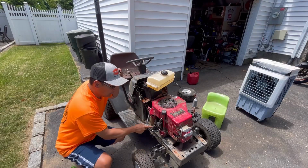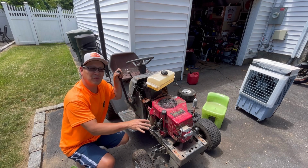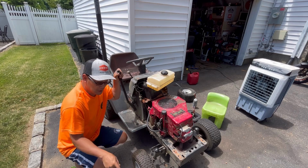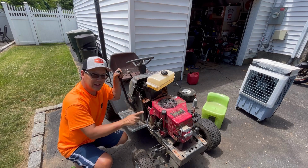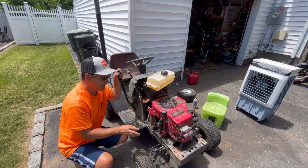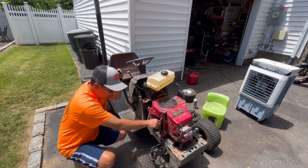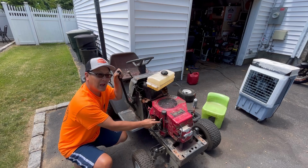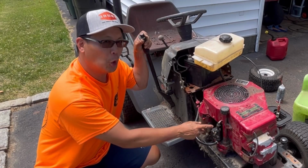As you saw, I took apart the mechanical fuel pump. It had all kinds of crap in it, rusted stuff in there. Cleaned it all out, made sure that the diaphragm was nice and rubbery, sprayed some lubricant in where the springs and mechanical part moves, and also cleaned out with carburetor spray the valves basically on the other side. And so then when I reconnected it again and tested it, fuel was flying out of here, spraying out of here, because this fuel line was really loose, you know, from overuse, so it stretched out the hole.